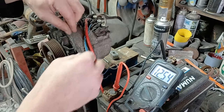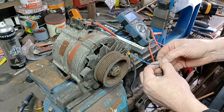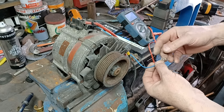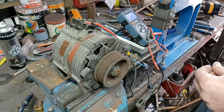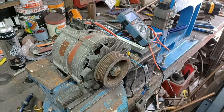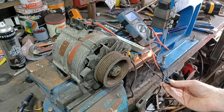Okay, so if this is our battery light, let's rig up a bulb for that and see if that's what we need to excite it. You're about to witness some very dodgy wiring — this is just a simple test to see what's going on. So what I'm going to do is sort out effectively an ignition switch. I'm just going to run a short fly lead from there to there — this would be a typical ignition light on the dashboard — and see what happens. Let's get a bit of wire on there. Right, that would effectively be our ignition switch on/off.